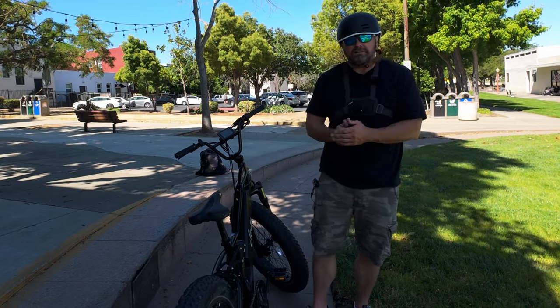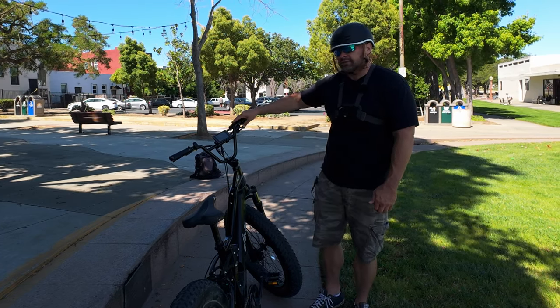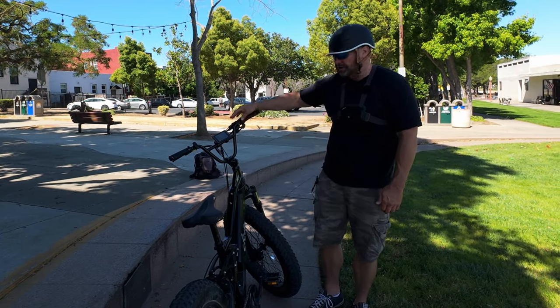So there you have it — do I recommend this setup? Absolutely. A couple of downsides: it's a tight fit with the shifter since there's not much real estate on the handlebars. But for a hundred bucks you absolutely can't go wrong. You get an additional gear, the lowest gear is five percent lower giving you extra climbing capability, and the derailleur clutch keeps the chain from slapping — almost eliminating all chain noise. There's still a tiny bit of noise on really big bumps, but going over curbs or rapidly changing elevation you're not hearing chain slap at all. The install took me about an hour and a half. Parts were about a hundred dollars — well worth it. I am not a fan of that Shimano Tourney derailleur at all. If you have any questions put them in the comments, and don't forget to like, comment, share, subscribe — catch you in the next one.